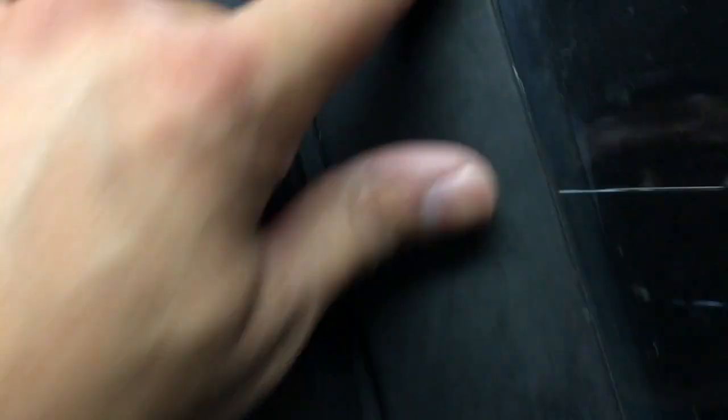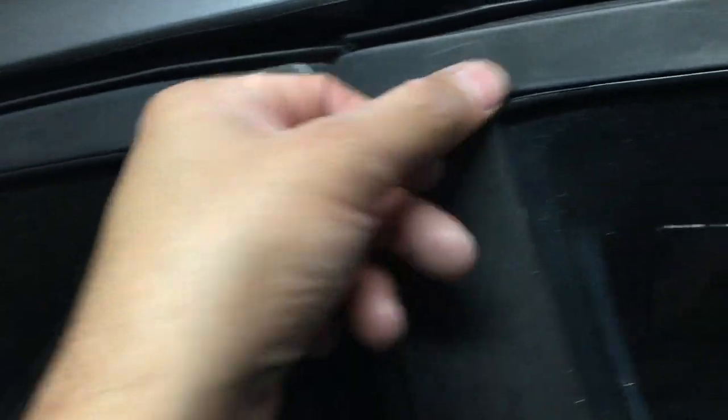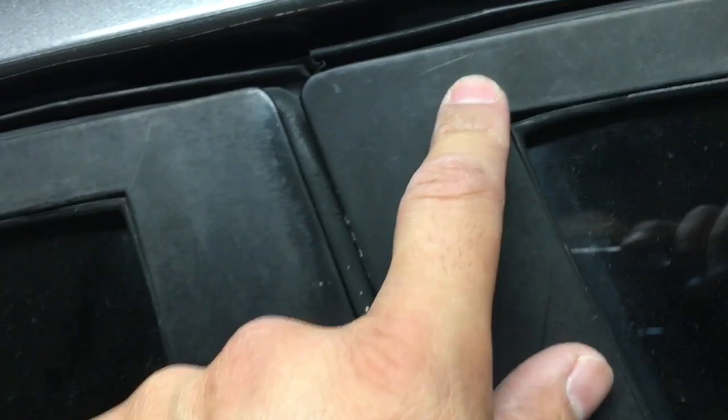I've removed the railing pieces and mirrors on both sides and scuffed some of this off. I'm going to do 400 grit on this, and for things like that hole I'll have to fill it in with some putty, then prime it a little bit, and then paint it.